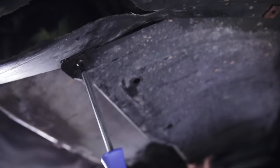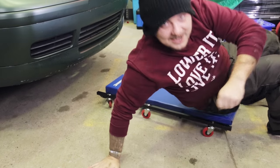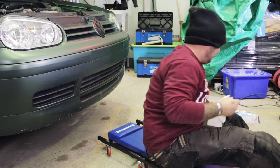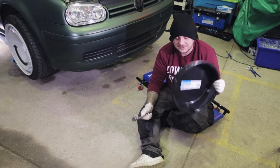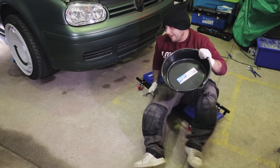Just get this under tray off. This is where the job gets a little bit messy — the thing about oil is it can be carcinogenic, so get yourself some nitrile gloves and get them on before you start. All you usually need to get the sump plug out is a box socket or a spanner. Don't forget you need an oil tray too, because it's much better than using your mum's washing up bowl.